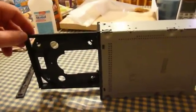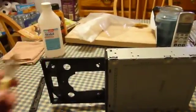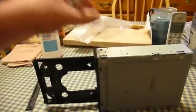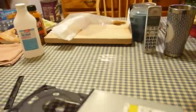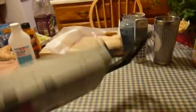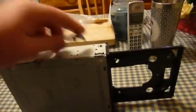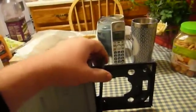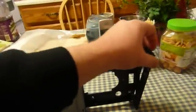Don't abuse the tray too much, because you'll strip the gear train that brings it in and out, and then you will have a problem. I use a kitchen tool here, and you need to liberate the front bezel. Flip this thing around and do the other half, and then the front bezel can be carefully brought free from the drive.